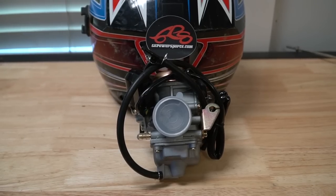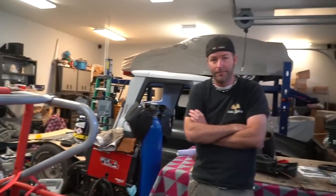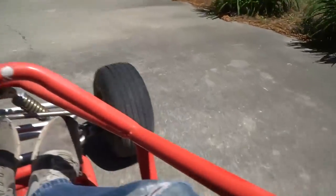Today we are going to start with the GY6 Yerfdog Spiderbox. What was going on was I was riding it and it would load up, try to cut off and stall. I had to carry a wrench around with me and whack the carburetor to get the float bowl to come back up or the needle valve to clear. It's flooding out. We need another carburetor, and we have one from gopowersports.com. We also have a new belt and new rollers. Apparently the rollers and the clutch are about the only things that wear out in these engines. We never got the carburetor problems on camera, so let's go for a ride and do a top speed run at the same time.